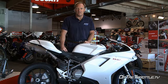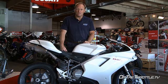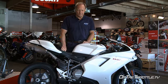And just like the 1098, we have a rear ride height adjustability rod to help with tire geometry, to make sure the chassis keeps the same geometry. And obviously you've got to measure the circumference of your tires to make those changes. So the chassis is completely and fully adjustable.